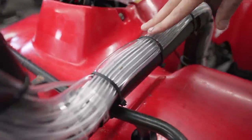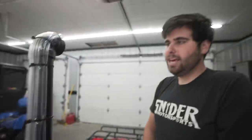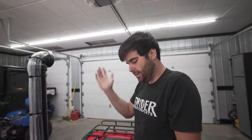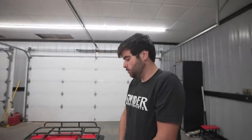As you can tell, we got a ton of vent lines ran. We got everything from every diff, every brake, every gas tank vent, every carburetor vent, the crankcase. I mean, everything is ran. Everything's watertight. This thing should run underwater like a champ. If it cut off underwater, it just wasn't meant to be because it is done right, baby.